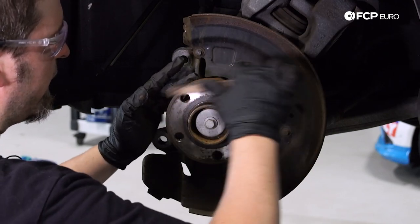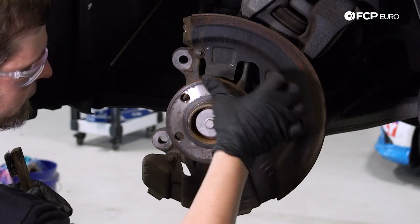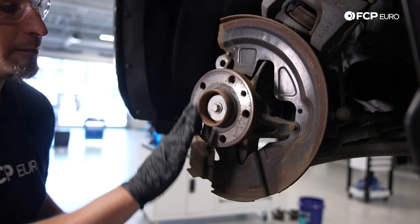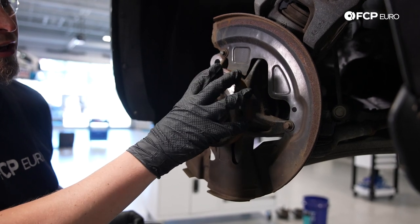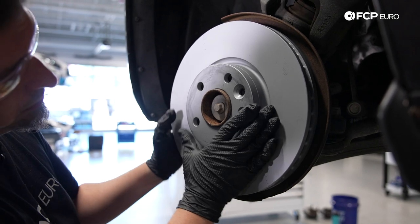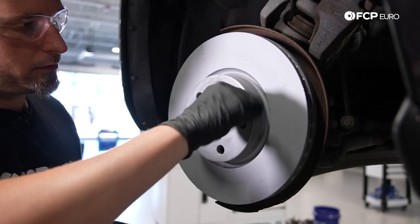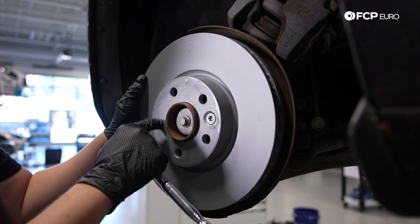This is starting to look pretty good. The key is to make sure that the surface is flat — you can sort of feel it. Even though it looks like there's a little bit of tarnish on there, I can feel around on the outer and inner lip and in the middle that it feels smooth. So we can go ahead and put the new rotor on. Make sure the surface is free of debris. Some people like to use an anti-seize compound on this; technically you're supposed to put it on dry so you don't get hub runout from the liftoff, but I think both are really okay. Once the rotor's on, you can use anti-seize on the threads of the set screw because that will get rusty. It doesn't have to be really tight — just snug it up so the rotor is in position and the lugs are all lined up.